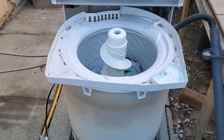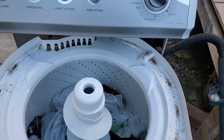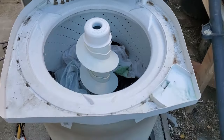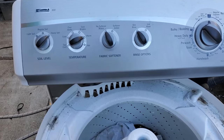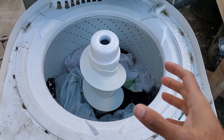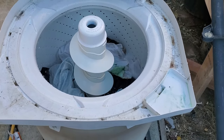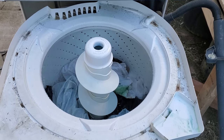I've got my washer hooked up to my little test station over here, and I've bypassed the lid switch and taken off the cover. One of the other problems of having a bad load sensing switch is that before, it was filling the tub and agitating at the same time, which it's not really supposed to do. That's one thing that's reassuring — it's no longer doing that.